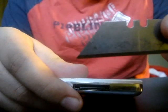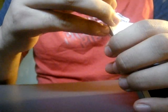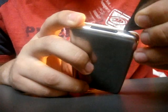Take your iPod and insert the thin blade at the bottom — that's the fastest and best way I've found, instead of starting from the side or the top. Insert it in the bottom right in between the seam, and you'll see it's already popping up. Then slide it over, and right here there's a clip — you clip and lift up on the plastic.